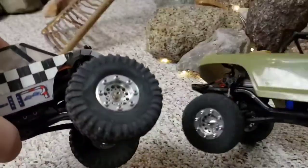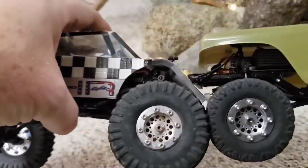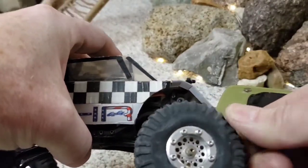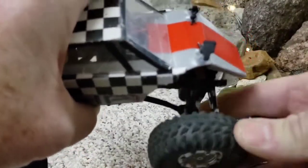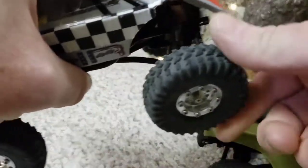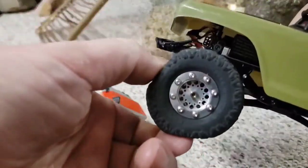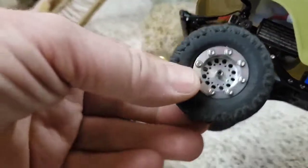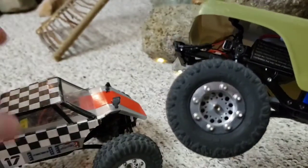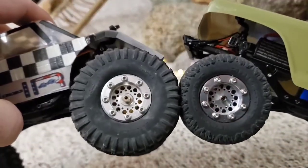Alright. Here's another note. Because these tires are vastly different sizes, you'll notice that the Scramblers do have a lot of sidewall flex. And the entire tire can deform a lot right and left. And that's great for getting grip. I don't see that these get any less grip, but the sidewall's a lot shorter and they give a lot more sure-footed feel. The difference is they just obviously will not have the same terrain clearance as the other ones.